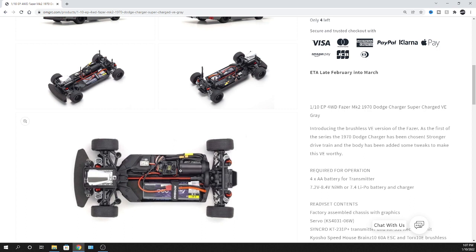And this one's got a fan on it, so good. The only thing you want to keep an eye on would be the motor, especially if you're running it when it's hotter outside, or just full throttle all the time. Normally what I do is the little finger tap, and like, ooh, okay, that's too hot to touch for a long time. If you tap it and it didn't feel too bad, you tap it a little bit more and you're like, okay, I can keep my finger on it. Okay, it's good.